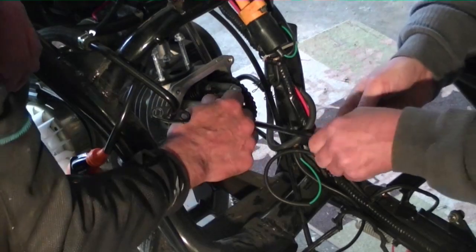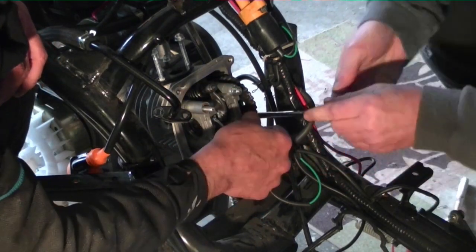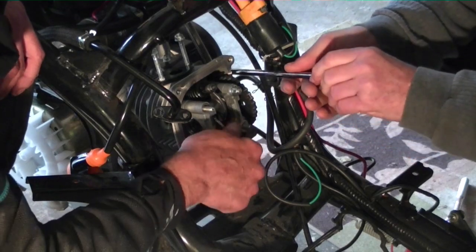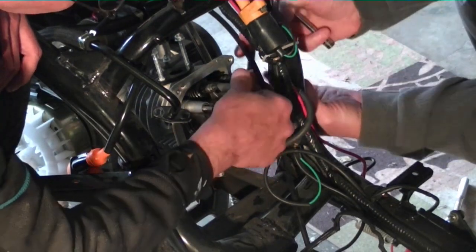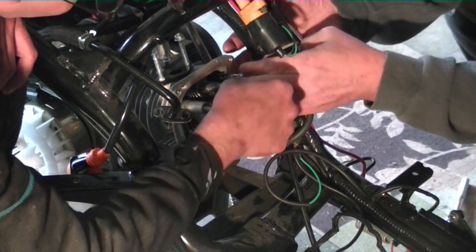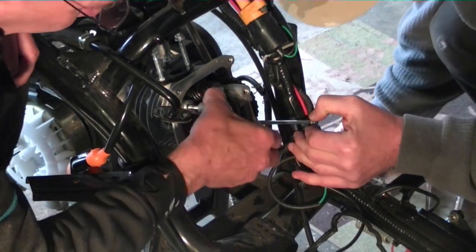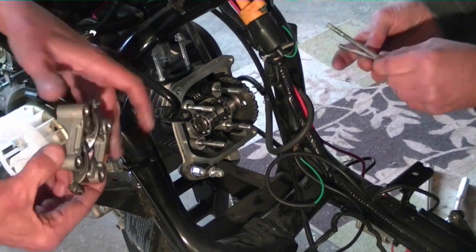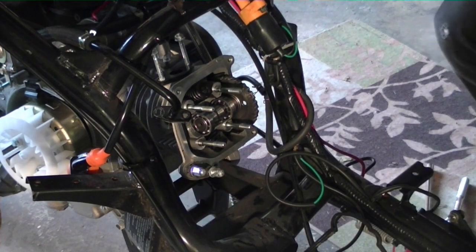I'm going to take these out. Those are long shafts. Let's take note of those shims, and we can take it off. I think he did have some shims locked in there, just stay note of it. Well, those would be obvious where they go. It was a washer. A little pilot. This is your valve tappets. And there's two bolts on the driver's side of the bike.